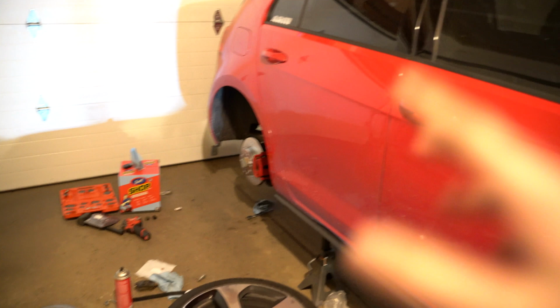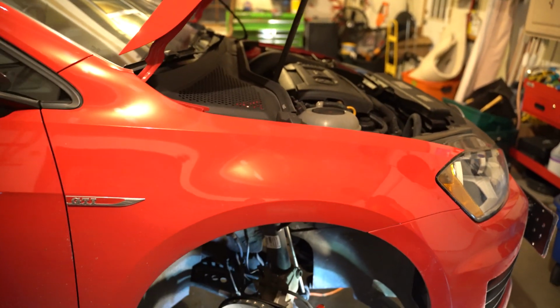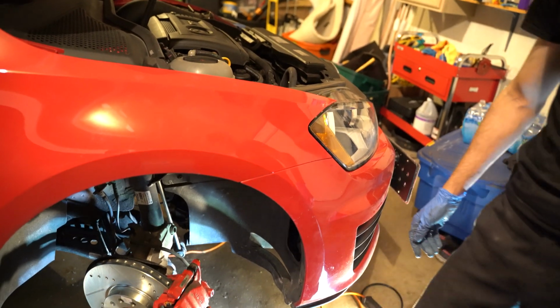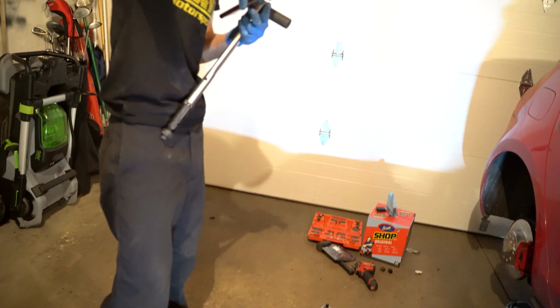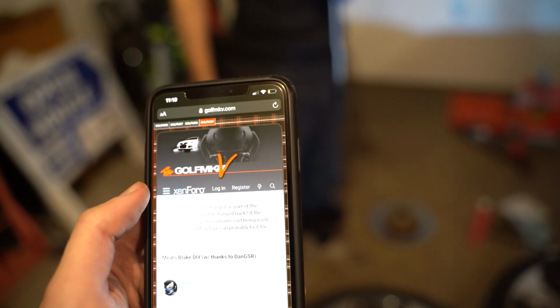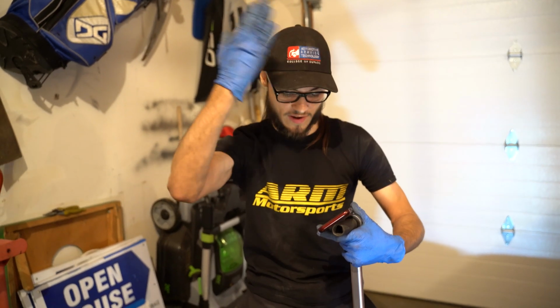The ones for the rears are 90 Newton meters. No. Wait. We need to reload. Pause, my brother. We made a boo-boo. Well, maybe. I think we did. I don't think so, though. That seems low then. Newton meters plus 90 degrees. And you did the 66 Newton, or 90 Newton meters to foot-pounds is 66.38059.